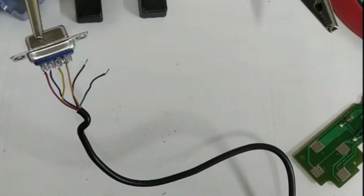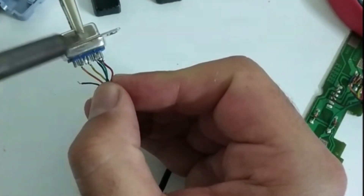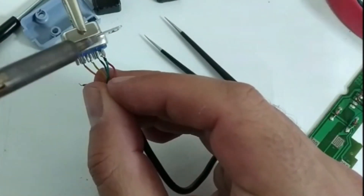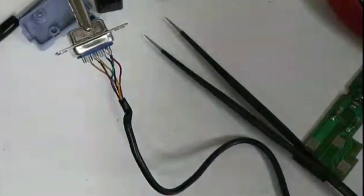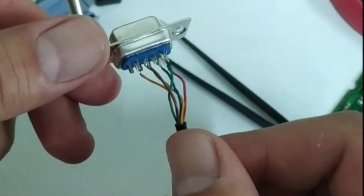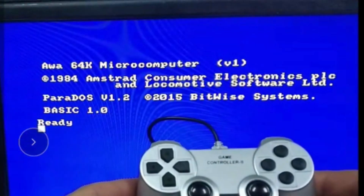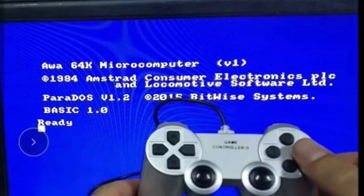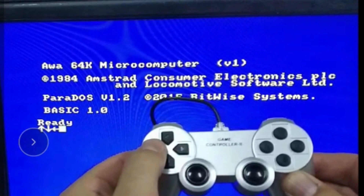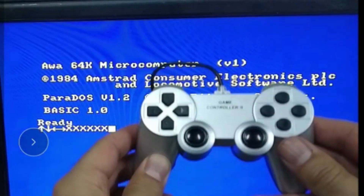Got the four pins in, now let's flip it around and get the ground and fire buttons in - pin six and pin eight. There's the wiring done on the plug side. Now just get this into the housing and get the game unit back together again and plug it in. I've plugged the joystick into the back of the Amstrad - pressing the directional keys should return ASCII up, down, left, right arrows, and the X key should return for fire. Up - yep, down, left, and right. Looks great. And also X for fire. Excellent! So now let's play some games on my new joystick. See you next week.